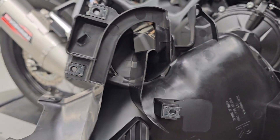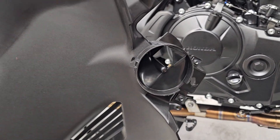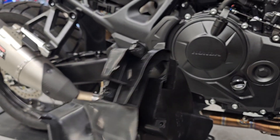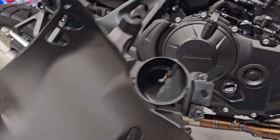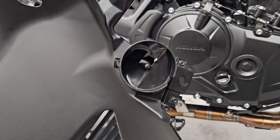This is probably to create some kind of pseudo ram air effect, but this is not a properly sealed box so you're never going to have any real ram air effect. Ram air only occurs on most modern motorcycles over like 120 miles an hour, which you're just never going to be doing on a TransAlp. So we went ahead and modified that side as well, got both back on the bike — and I'm honestly not going to bother showing you a dyno graph because it's depressing. It actually made things worse by like half a horsepower in some spots, but effectively still did absolutely nothing.